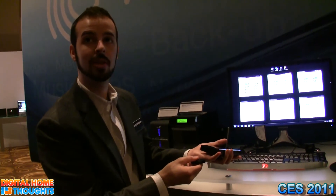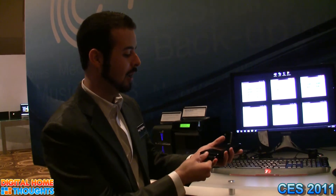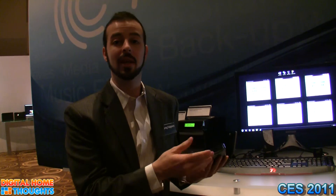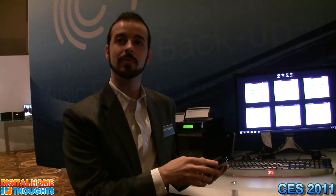This bottom part is our GoFlex adapter, so you can have USB 3 out of the box. You can go to USB 2 if needed, FireWire 800, eSATA — whatever your flavor. Of course when new interfaces come out you can simply upgrade. What's cool about using USB 3 is that the spec has enough power to run both of these drives, so you don't need external power.